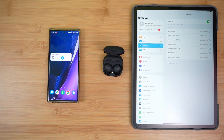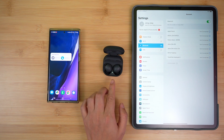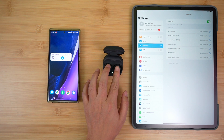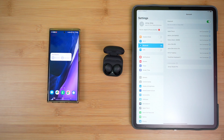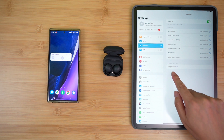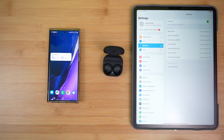I've done a bunch of searching and eventually found the solution. What you actually need to do in this situation is keep both earbuds in the case and hold both earbuds like this. You'll see the light starts flashing in a cycling pattern of different colors — that's the sign that it's now in pairing mode. And you can also see that the Buds 2 Pro actually pops up on my iPad, and I can click that to connect it.